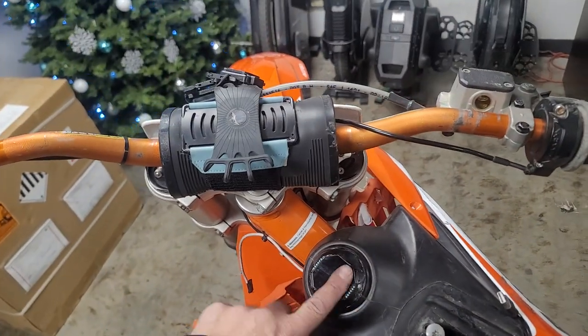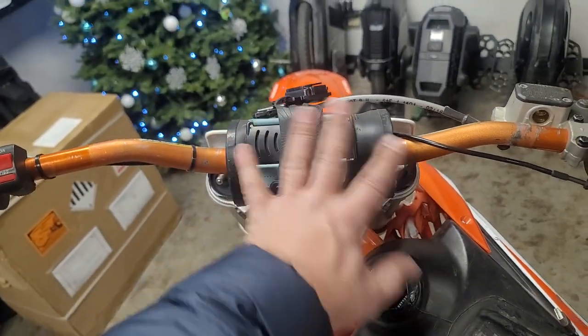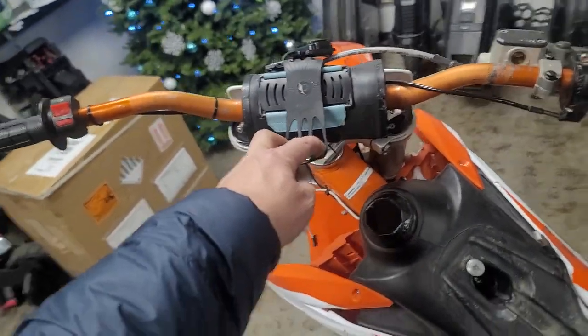I've got a little glass LCD screen I haven't hooked up yet. I'm going to put a permanent CAN bus screen up here when that comes out. Otherwise it's just a phone — I've got the METR app, so I can see live data. If I want to know how many phase amps I was using at a particular part of a hill climb, it's logged 100 times a second. Phase amps, battery amps, wheel speed, temperature, motor temperature — I've got it all there.